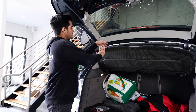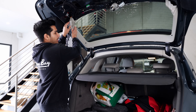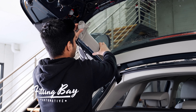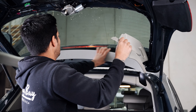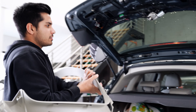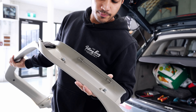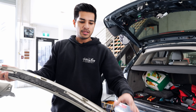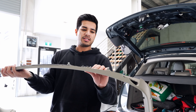Next up, just pop this panel down. You don't need to remove it all the way - you can if you want, it just pulls out. This panel here, same thing - clips, just pull back. The clips are very tight. Take note: there's two here, and one, two, three, four there. So when you're pulling, try to pull where the clip is so you're not putting pressure on the flexible part of the panel - you're putting pressure where the clips are.